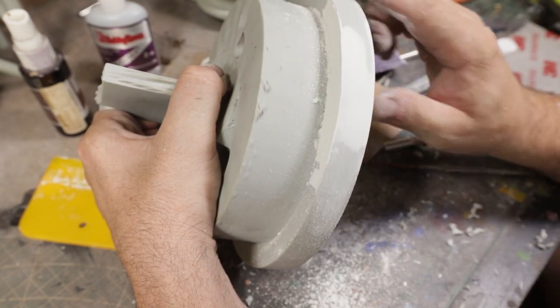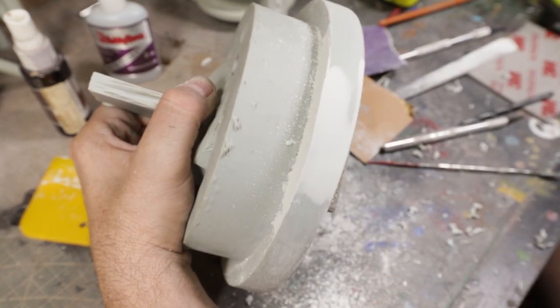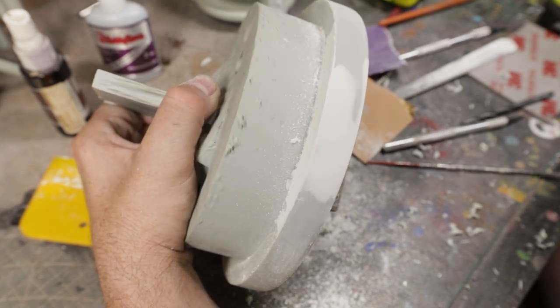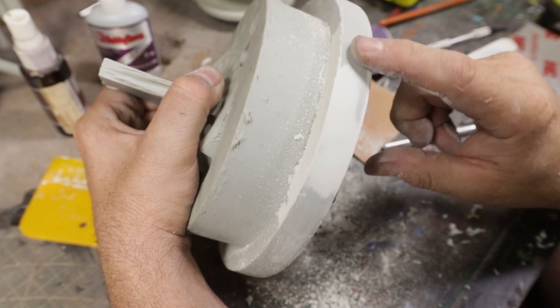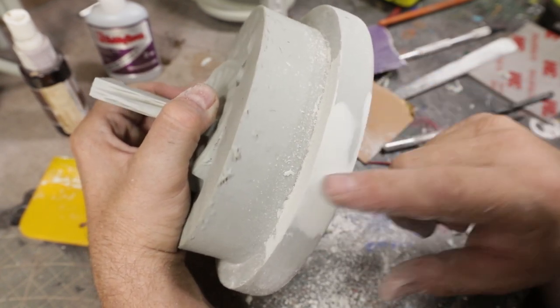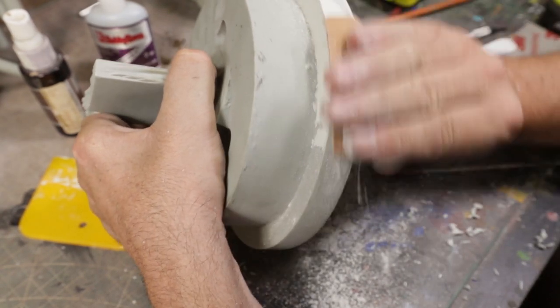And so when you're sanding body filler, again, it's really important to kind of feel over it as you're doing it. Exposure's a little bright, but you can see here how it's a really smooth feather. The body filler has no definite line, just a smooth transition. That's the sign of a good repair with body filler too.